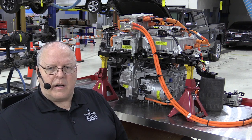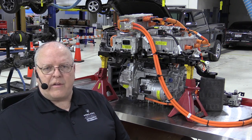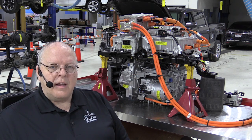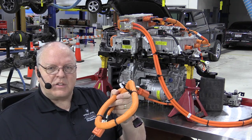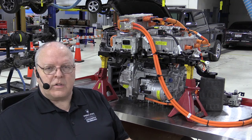The other thing I need to address — it's not really a correction, but I forgot one harness for the high voltage system. This harness has a different part number and is wired differently depending on whether you have DC fast charge or not. So let's take a look at what this harness is and where it goes, and then we'll get into the cooling system loops.